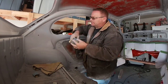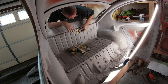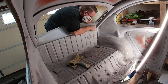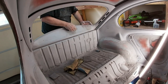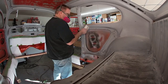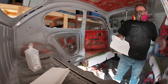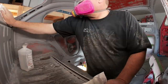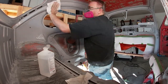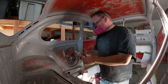As I get into sanding again, I wanted to note that I've been stepping up the sandpaper grit. I started off, of course, with 80 grit and 150, but those left sizable scratches. So using multiple layers of filler primer, I filled and smoothed the big scratches. Here I am using 400 grit. After the finer sanding, I use soapy water and an alcohol wipe to wipe down and remove excess debris. Then another healthy layer of filler primer went down to fill the scratches left over from the 400 grit paper.